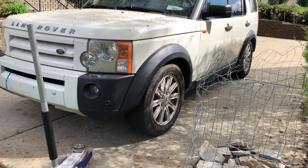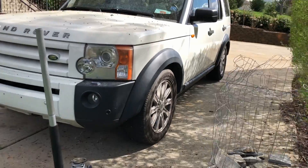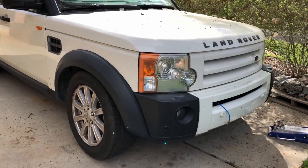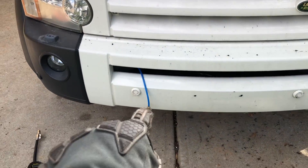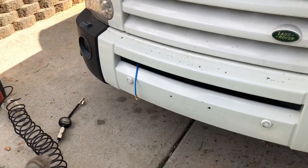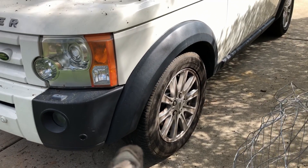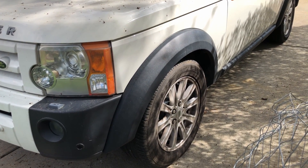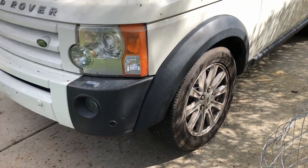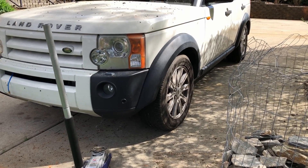It may not look like much, but it's a big improvement. This side is now sitting considerably - more than an inch higher than the opposing side. I found the leak was just that the core of the Schrader valve wasn't spun in tightly enough, so it seems like we don't have any leaks now. The only limiting factor in testing is that my air compressor goes up to 100 PSI, and normal strut operating pressure is about 114 to 140 PSI, just slightly below 150. But this is already keeping it off its bump stops, which is a big improvement.